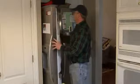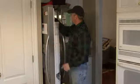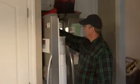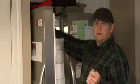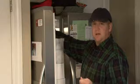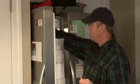Up top here, you have your ice maker, which is simply a tray. Inside the ice maker mechanism, you have an automatic faucet that turns on and off. When the ice tray is empty, it'll turn on and dispense just enough water to fill up the tray inside the ice maker.